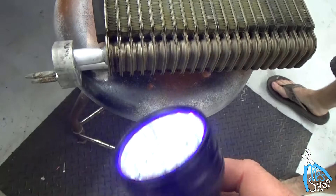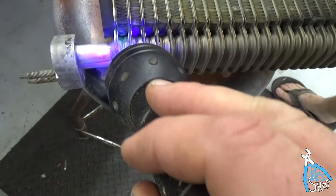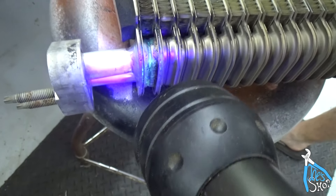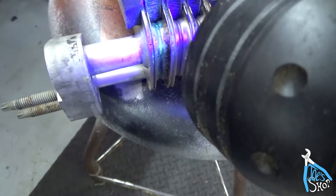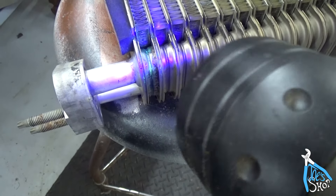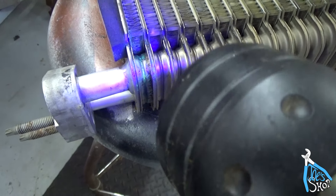This is one of those UV lights and you can see it picks up the color there — the lime green, neon green. Dave was correcting his educated guess — it did blow out here at the evaporator.